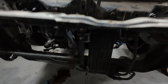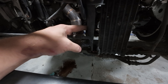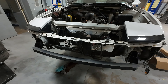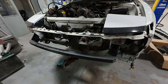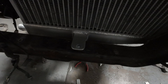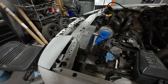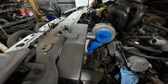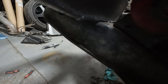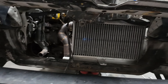You might be wondering: if the power steering's leaking, why are you pulling out the radiator? Well, I need to pull this engine out. I'm going to do the rack and rebuild it with some seals. I threw this thing together with a bunch of used and garbage parts, and the clutch is just making a crazy noise, so I need to swap that out — engine needs to come out for that. And I figured while the engine's out, I'd have plenty of access to the rack. So order of operations, I'm just going to wait to do the rack and stuff like that.